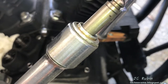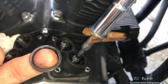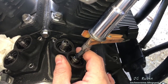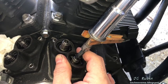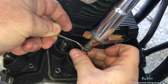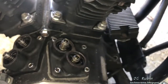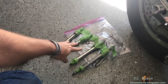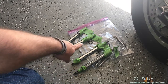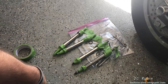This O-ring stayed up top, and this O-ring stayed on the bottom. I now have all four rods labeled and removed. All four top O-rings that were sitting in the heads have been removed; the other four are sitting in by the lifters and those are just fine for now. I'll remove those in a bit. We're going to move on to the next section.